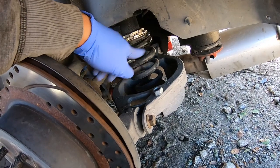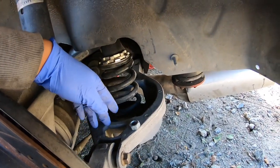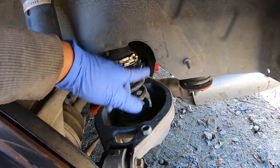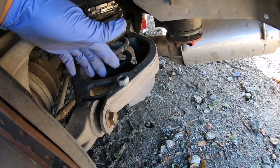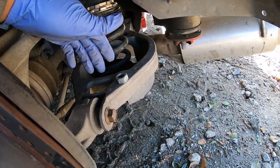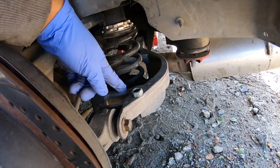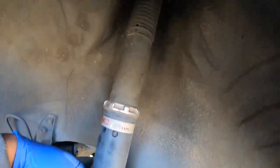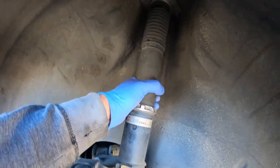But basically, I'm gonna take this off. It's really easy to do this job. You basically just take off this thing, drop the shock. So it's one bolt, but I'm gonna get another jack put underneath it, because it's gonna be on a lot of load right now when I take it off. So I don't want it to hit somebody, or me in the face, or you, right? So we're gonna put the jack underneath it, take it off. This one just has a bolt on the bottom, the 212s on top, and then we can start beginning the actual work to do the job.